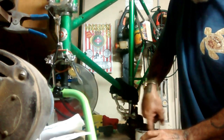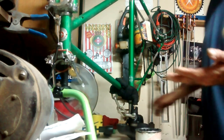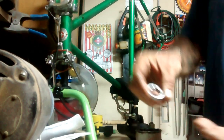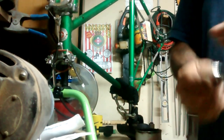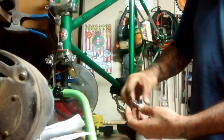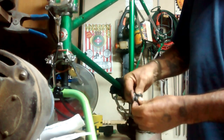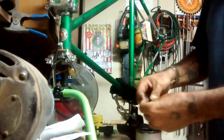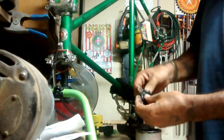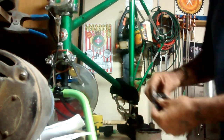You want to get a little glob of grease and put it on the palm of your hand like this. Then you take your bearing, that side down, and you want to scoop the grease in like this. Get it all good and saturated around — pack it in there between the bearing and the cage. Get it all good and gooey, because you don't want to end up doing this for a while; you want to do this like maybe once a year. For all you motorized bike guys — remember, your motorized bicycle is mostly a bicycle, and this is one of the things you have to do to maintain the service of it.